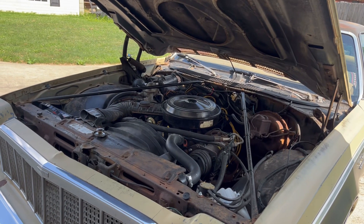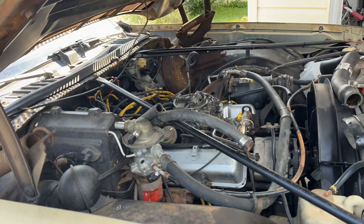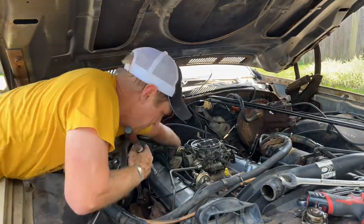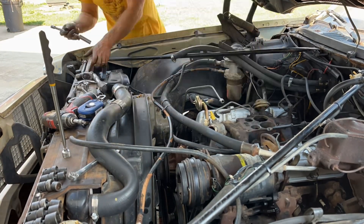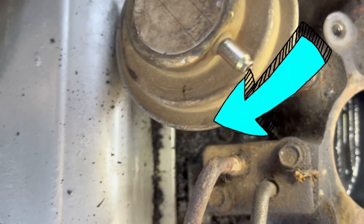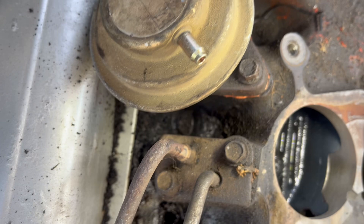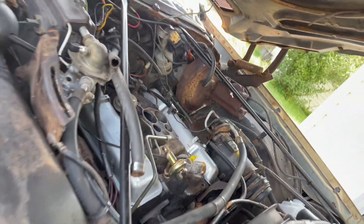I think the best way to do this is probably going to be mostly time lapse, because it's just ripping a whole bunch of stuff off the top of this thing. I've almost got the intake off, but the problem with these small block Chevys of the smog era is trying to get to this last bolt — it's right here behind the EGR. The way this intake is built it is just really hard to get a socket on here, especially with corrosion and carbon. I'm fighting that one last 9/16 bolt, then we get this intake off.